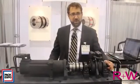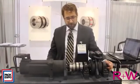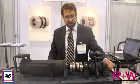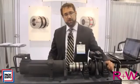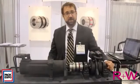After our safety coupling disengaged to prevent transmission of torque overload through the driveline, we shut down the motor. We're ready to re-engage after clearing the jam. This is our full disengagement torque limiter. There are some models that will attempt to re-engage on their own, but this one is a manual re-engage. It's good for situations where the overload may not be sensed immediately and also for higher speed applications.